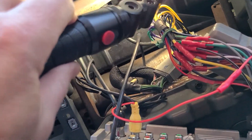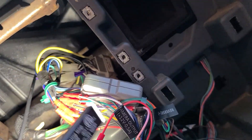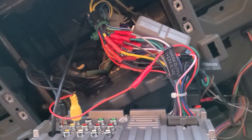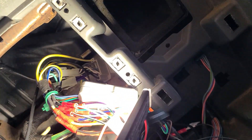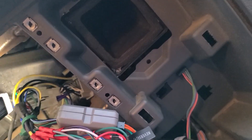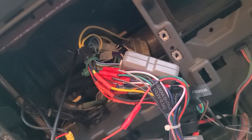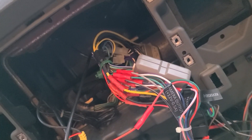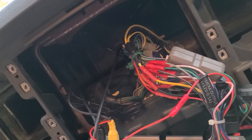I'm going to put a bigger tie strap up around here and tie-strap some of these cables to put some strain relief on them, so if it's bouncing around the weight won't hit this connector as much. I really don't know what's knocking it loose. I'll probably throw a couple around this connector and some of the smaller ones around that big connector to cinch everything down a bit. For now it's working, but I have to reprogram it again.